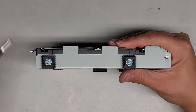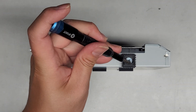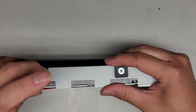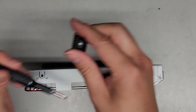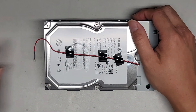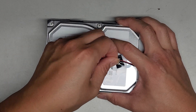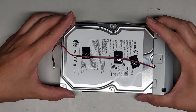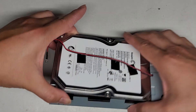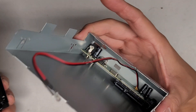We're going to take out these screws — just like this. We'll go over here and take these out as well. Once we get these out we should hopefully be able to slide the drive out. We do need to peel this light thing away, so let's get that out of there. We'll grab this and wiggle it as we slowly pull — and there we go. Here you can see the SATA adapter in there.